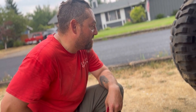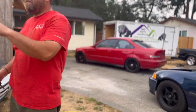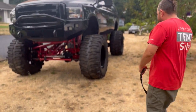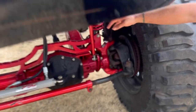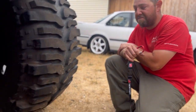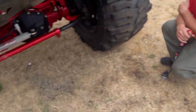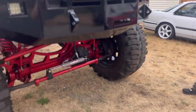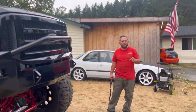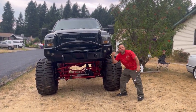Look at the exhaust — it's so crazy. I can basically just squat underneath it. Driving this thing is crazy. It's so wide — you have like maybe a foot on each side in the lane. The steering's actually pretty tight since he replaced the bolts in the subframe bracing, pitman arm and all that stuff — they were missing. This thing had really bad steering wheel play when going and it would vibrate. It's tightened up a lot more. There's still a little bit but it's nice.